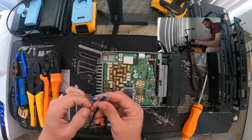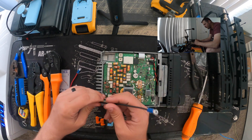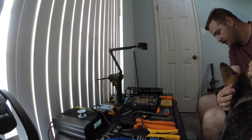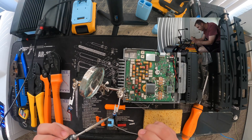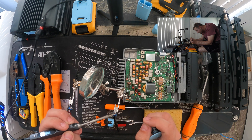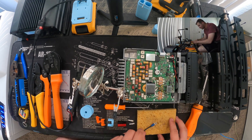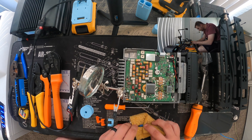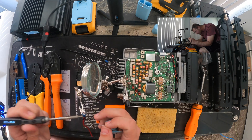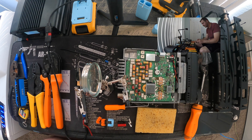Get the connector held in by the jaws on the first click, insert the wire, and give it a pull check. I'm going to solder these just to be on the safe side - if you already know how to solder, you know how to solder. I run the iron at about 400 degrees. A little bit of solder on the tip first helps start the heat transfer. Get it in once you hear the solid click. You don't want to make a cold solder joint. Also, if you have a dog, make sure they inspect your work - better than OSHA.